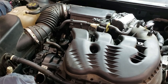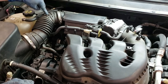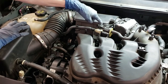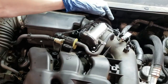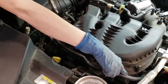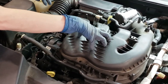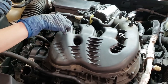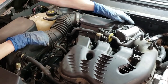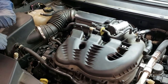First thing, I'm just going to point out some of the things we're going to start removing. Obviously this air intake hose — we don't need to worry about this but we will be removing it. These hoses and all of these wiring harnesses are going to get unclipped and pushed back. And then this hose here on the front, I'm going to disconnect this so that I can push it forward so it's not in the way of taking down the intake manifold. I'm going to be using screwdrivers for the connectors and to loosen these hose clamps. I know this box has got a bolt on it but we'll get to that when we get there.